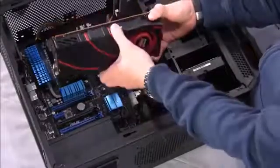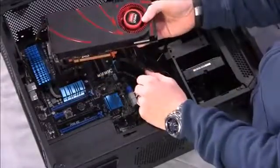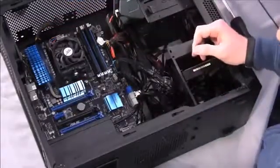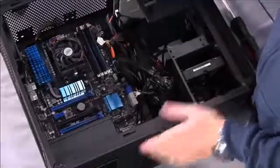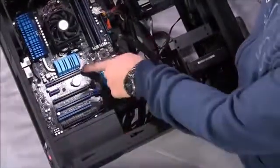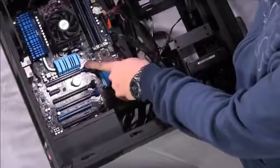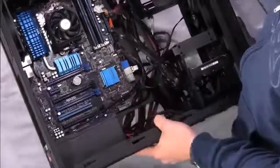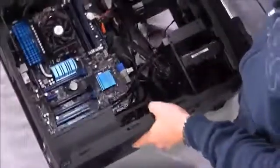If you go on the build specs that we use, it'll be a slightly different look, but it's a retail card. And this is going to go into these PCI Express slots that you see here. There are a whole bunch of them. We've got 4 of them available, but the one you want to use is the one closest to the top. This one here is the primary PCI Express slot. That's the one we're going to actually install it in.